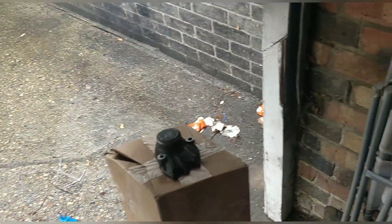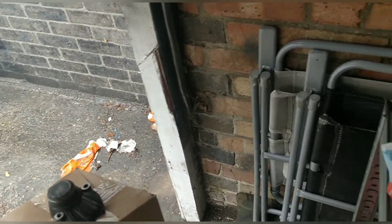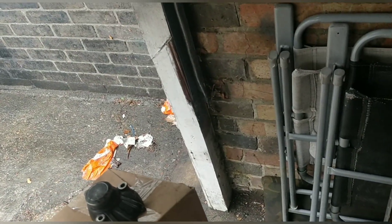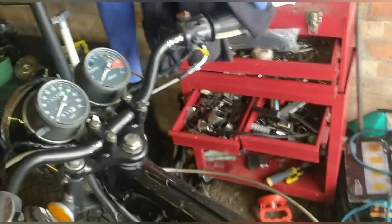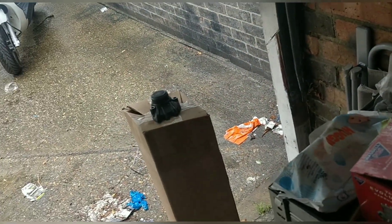I can't get this off — it's a bit stiff. Otherwise I'd have given it a silver coat, which I've got. But with a good 2K clear you don't need to worry too much about deep coats, especially in matte. A few light dustings, one thick coat that's not running, then let it sit a couple of days before the 2K clear coat. My aim is one warm day to clear coat the forks, the brake stuff — all of it in one hit.